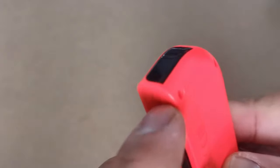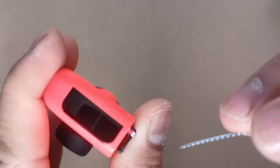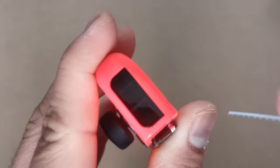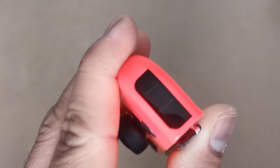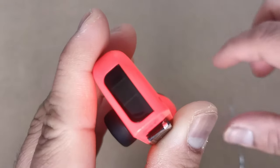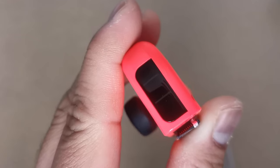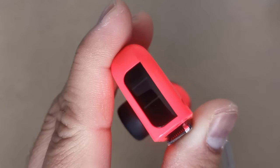I actually do have a bit of tape at the top end as well, and that is fine, as it is not touching any pins and will help the foil stay in place. I'm showing here how to push the foil in place from the inside. This is where a small flathead screwdriver would have worked best, but the paperclip worked just as well. You want to ensure the foil is flat, and it is pushed down against the pins gently. Again, you only want pins 9 and 10 covered.